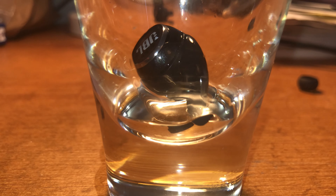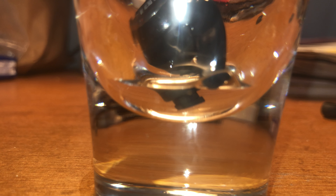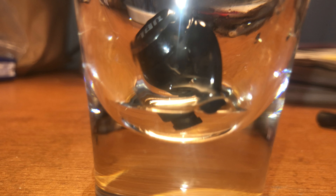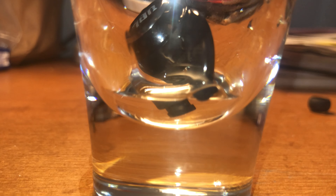I'm not going to dunk the whole earbud in there. Luckily this version here, these earbuds are actually waterproof so they may be okay to stay in the alcohol for a little bit longer without being damaged. But especially if your earbuds are not waterproof, you don't want to dunk the whole assembly in there because otherwise they may just drown and die. So I'm just going to leave this sitting in here for about half an hour and let the dirt and grime and earwax — whatever is in that screen — slowly dissolve.